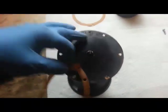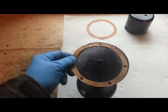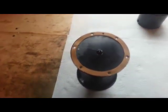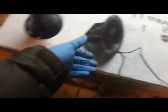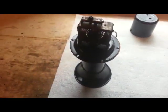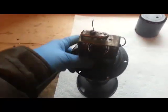The next step is the next set of gaskets. You can see now we have two sets of holes close to each other, and so do our gaskets — we're going to just place this on here. Once our gaskets are in place, the two sets of gaskets on top of that disc, we're going to take our motor assembly and line up this open tab here with the one on the disc. Once we have our motor assembly in place, we push it down to make sure the gaskets are all lined up, and it should look like this.